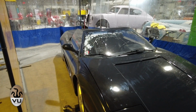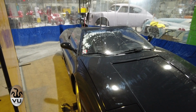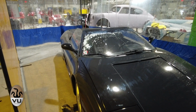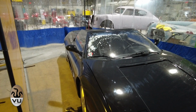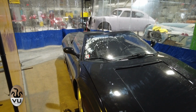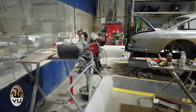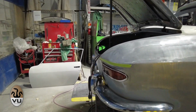What needs to happen is the engine needs to be pulled and a full service done, because obviously it was around some heat, and you can't trust the belts, hoses, high pressure fuel lines, or anything like that. But for somebody who wants to put some work into it, it'd be a good entry point. I'm always trying to convince myself to do it, but I've got enough projects.